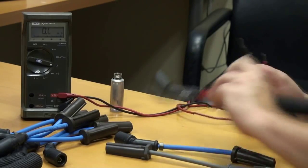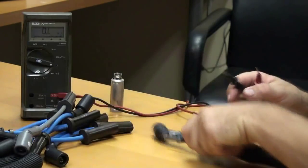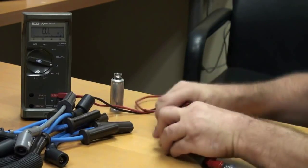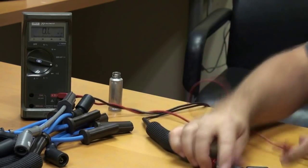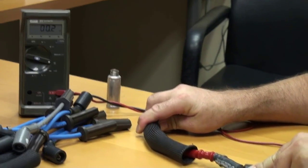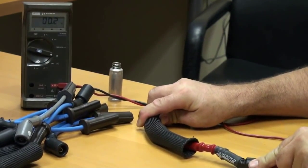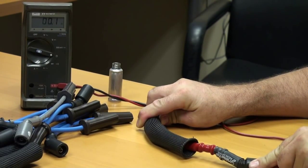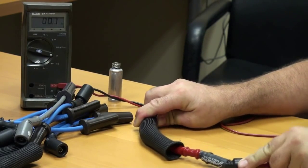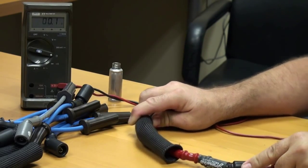And just to show you this is the same, we'll then go to this wire, which is the same wire except with the red sleeve over it. And again, the Granatelli 0 ohm wire, this one is basically a solid 0.2 ohm drop. Now we're down to 0.1, so less than 1/10 of 1 ohm drop. Now let's go back on the dyno and see if there's an improvement.